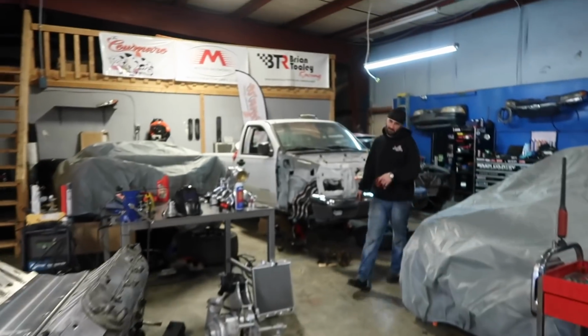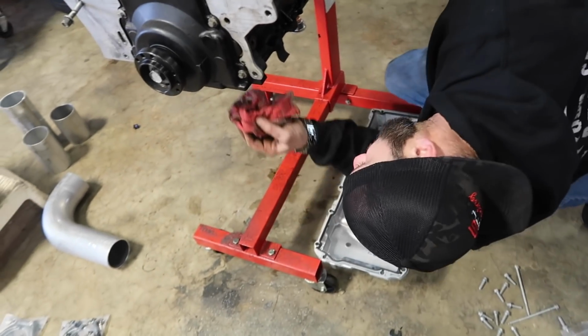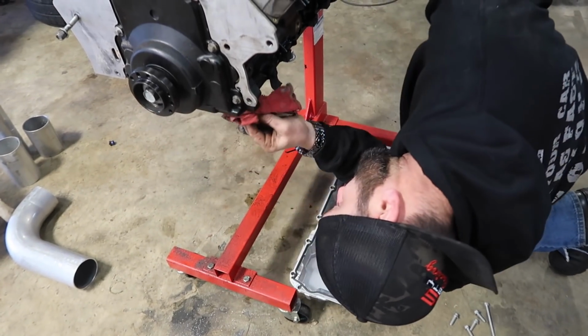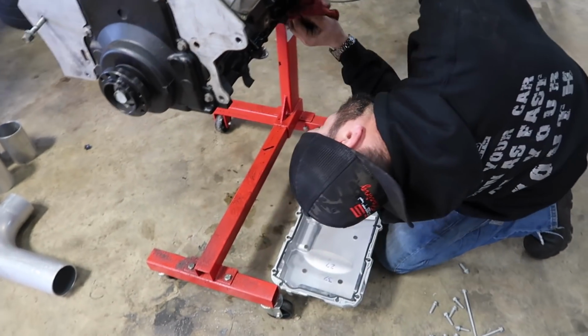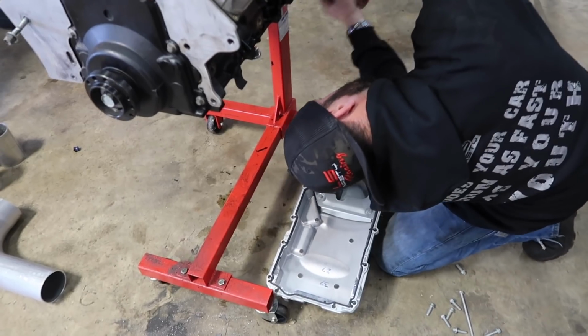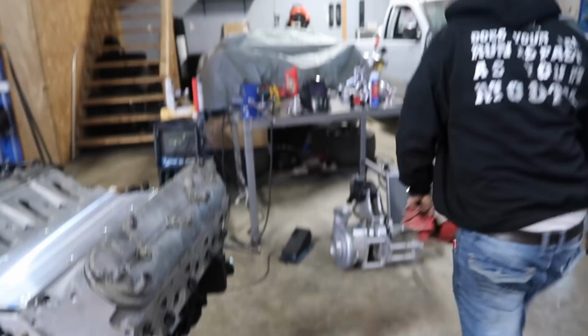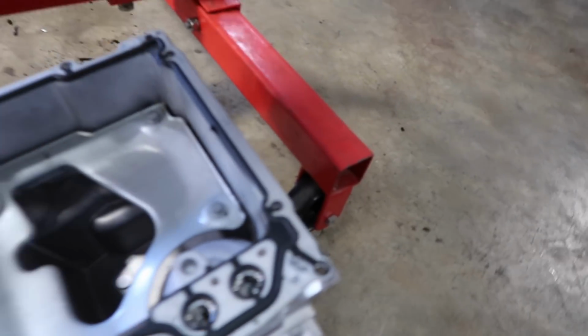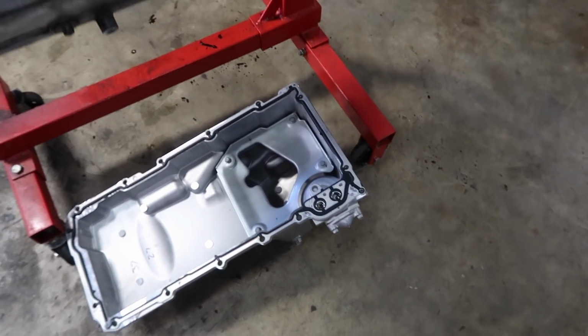Tangerine. All right, Joey. What does everyone need to know at home when they're putting their oil pan on? Silicone in all 4 corners, or you will have leaks. Bad ones. We don't want those. No. There's nothing I hate more than a vehicle that leaks, and all of them leak. They all leak. Except for Jackson's. Jackson's truck don't leak. Joey's adding the dollops of silicone on our oil pan gasket. We ain't got no rear cover yet, so I ain't gonna put none on the back.